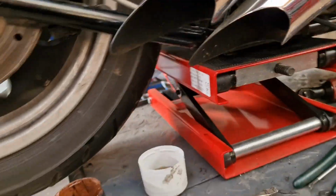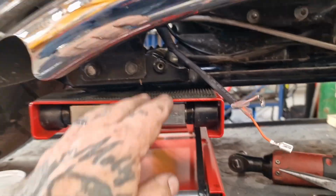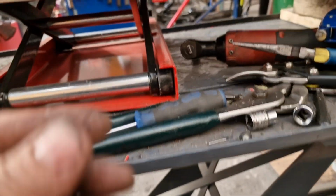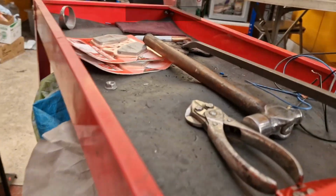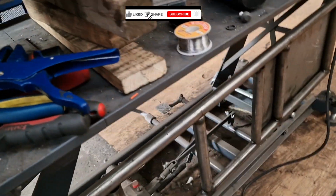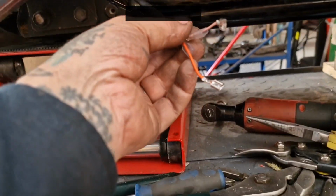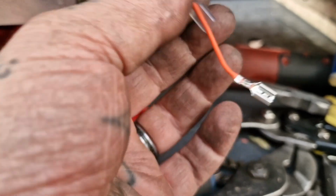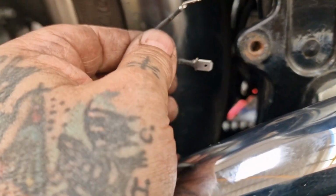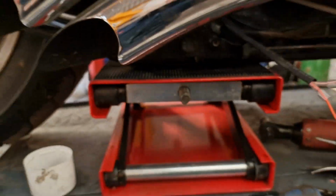So we're all in place there. The hose is done, the line. I'm just going to connect up the brake light wires. I'm just extending the originals with some spades. They have a socket that goes over. I've not got it here now. It's not to hand. Where have I put that? I don't know. It's here somewhere. But they have a socket that goes over the original brake light switch, and obviously we've removed that now. So I'm just extending the wires down. I like these little ends. I crimp them on and then solder them on, and then they have their own little bit of silicone. And same with the male counterpart, only I'll put a little bit of heat shrink on there just to tidy it up, and they'll do it.